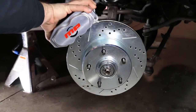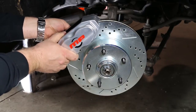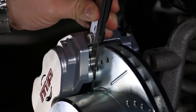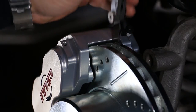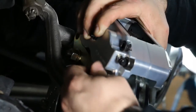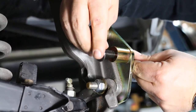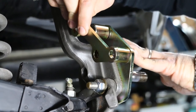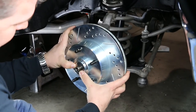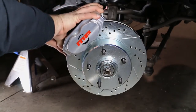With the rotor in place, install the caliper on the spindle to begin the shimming process. Shimming of the calipers is required due to inconsistent wear and machining of the spindle. If not shimmed, the pads will wear unevenly. If shims are required, remove the caliper and rotor and shim between the primary and secondary caliper mounting brackets. Once complete, reinstall the rotor and caliper and determine if additional shims are required. This may take several attempts to get just right.